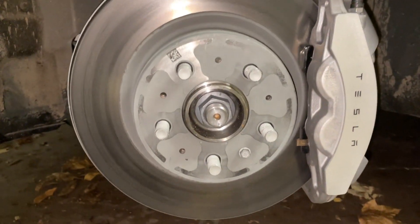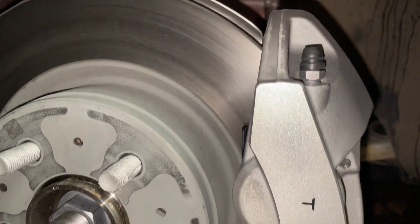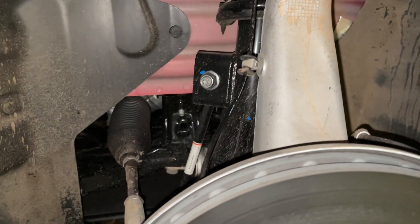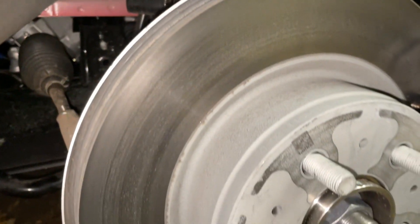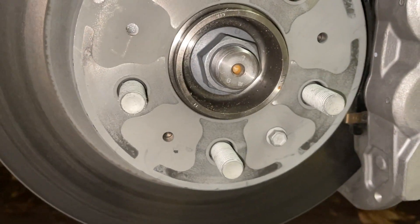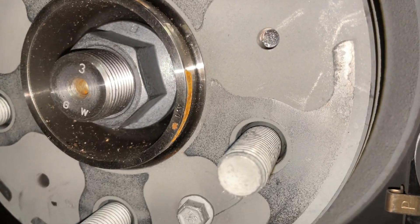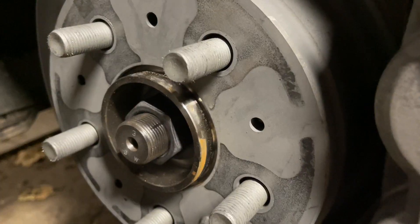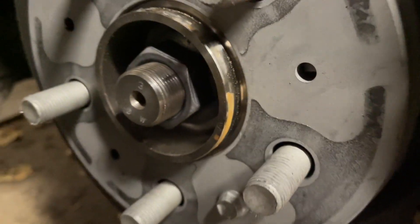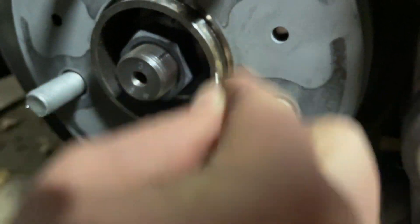Inspect your wheel assembly area to make sure everything looks clean and doesn't have any unusual wear. The video here shows mine, which is less than 5,000 miles old, and you can see it looks pretty fresh. You can see that the hub here has a little spot of oxidation — this is completely normal for any car, and there's not much you can do about it. There are some products you can apply, but be careful and make sure you're using the proper products and don't get them on the wrong part of the wheel assembly. What I do like to do is clean the rust off with a dry wire brush or a Scotch-Brite.